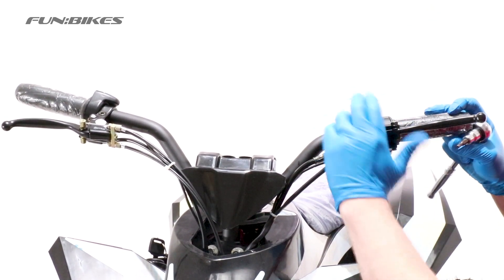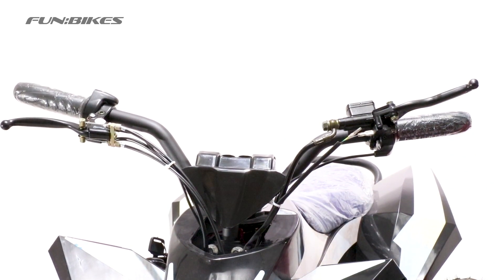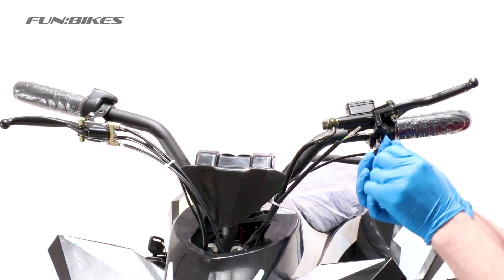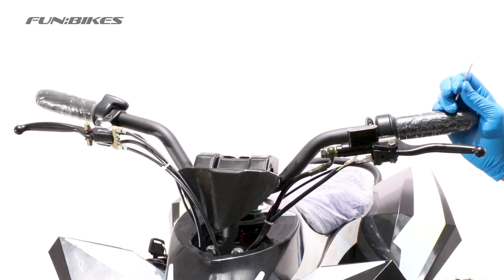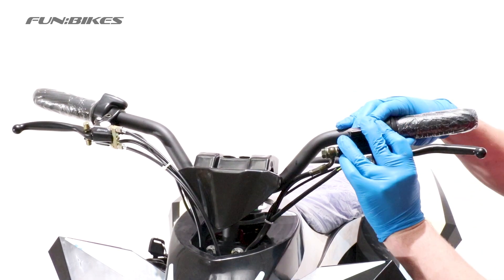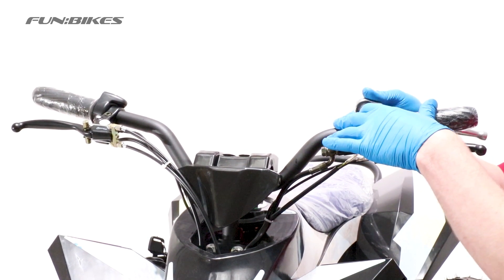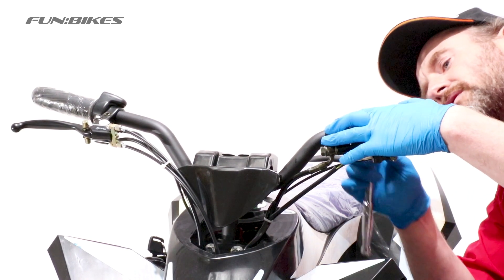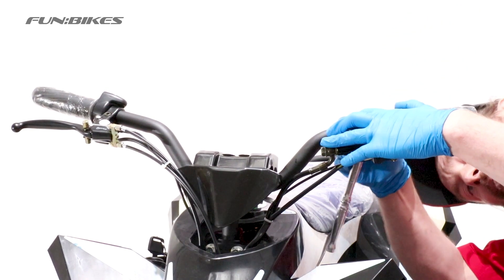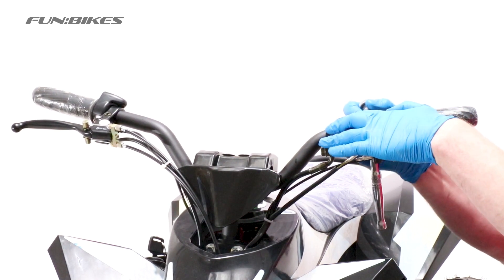The first thing you will actually need to do is loosen off the lever and angle it upwards to allow you access to the grub screw to move the horn unit down. Once you are certain you will be able to get the brake lever to the same angle as the opposite side, move it back out of the way and tighten up the horn unit and then reposition the brake lever, fully tightening it. As you tighten it, make sure the gap at the top and the bottom of the retaining clamp is equal.